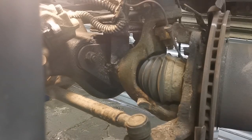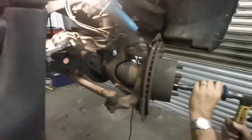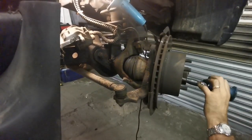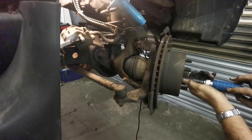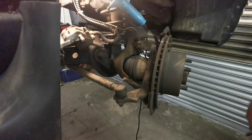Next thing — we've got the big hub nut in the centre and we've also got the little screw that holds the disc. These impact drivers are brilliant to get these out — rather than trying to get a screwdriver in there, you just whack it with a hammer and straight away it comes loose. Once that's off, we can get the disc off.